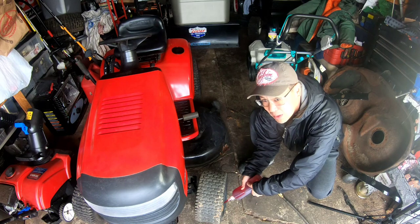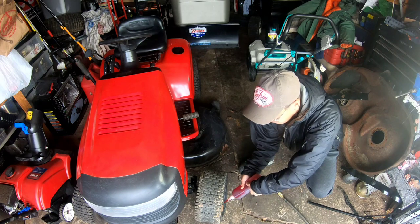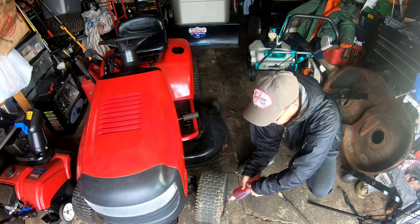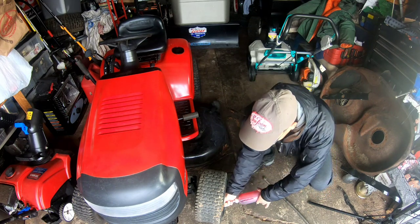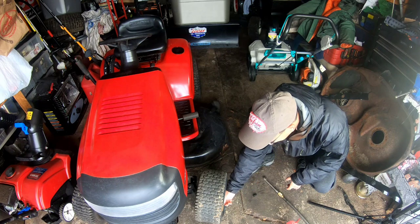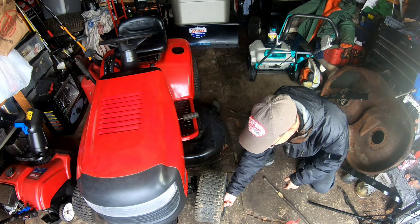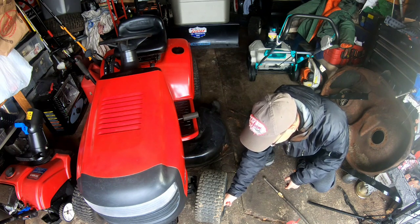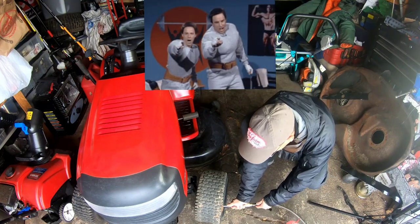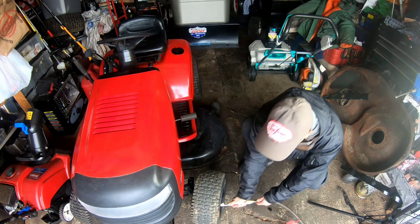I use the slime bottle because the hose attaches right onto the valve stem of the wheel, as it's supposedly designed, you know? So it makes for a good applicator for putting in ATF. Once I put in 8 ounces or more of ATF, I put the valve back in using the little tool that it comes with, onto the stem, and then pump it up. Boom!